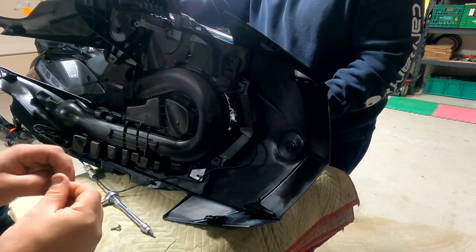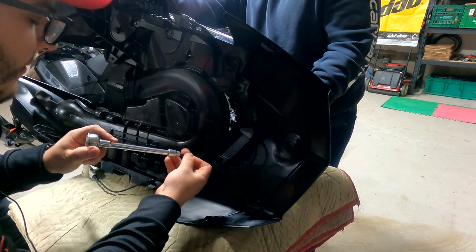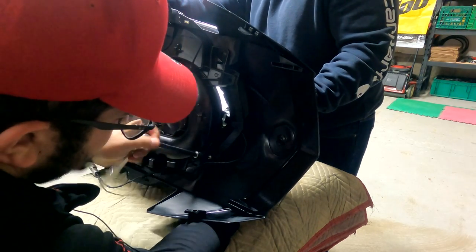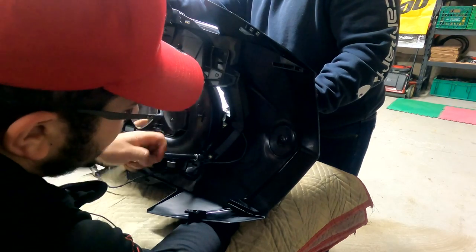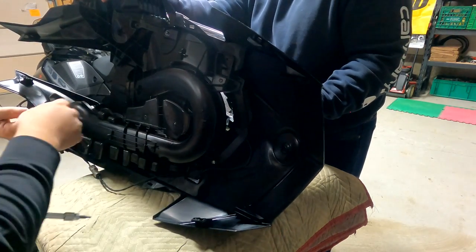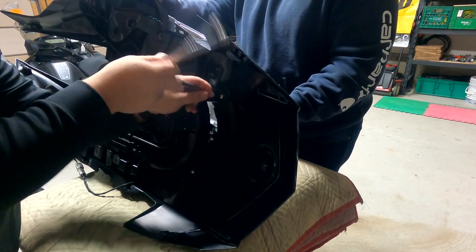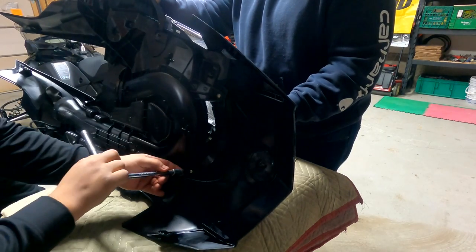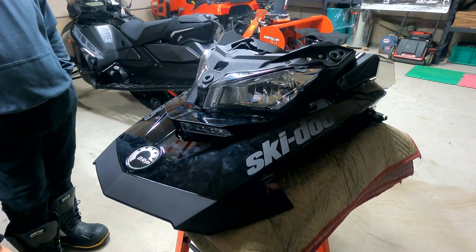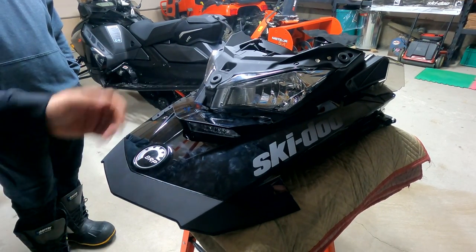So as I mentioned, we want to fasten the light on. It's just the same stock screws that we took off before. You don't want this to be over tight because it's going into plastic, so just until it's relatively tight. Put on the other one first, and then tighten both of them down together. This is what it looks like all installed — looks awesome. And what we're going to do now is just work on routing that wiring harness underneath, and then we're going to install that heat protectant layer again like we took off at the beginning.